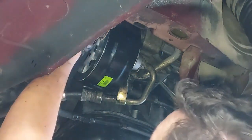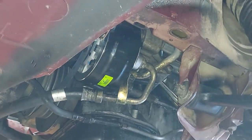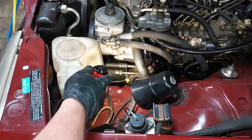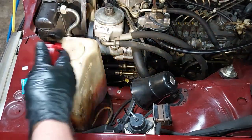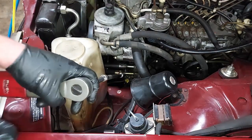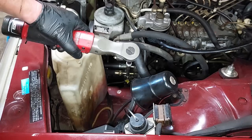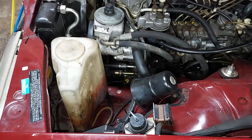I think I did that in about 10 minutes. Plug our power back in. Now we need to snug everything back up, then lower the car and recharge it. We have an adjustment nut right here, and it's very important that you get the tension on the belt tight enough, or the compressor will make a lot of noise — it'll sound like marbles in a tin can. That feels pretty close; let's go ahead and tighten up everything underneath.